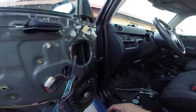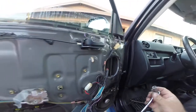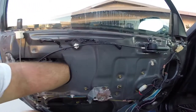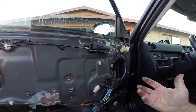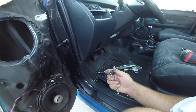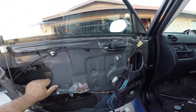So what I did was I unbolted the motor off of the lift mechanism first, which utilized an 8mm ratchet wrench. So I had to get my arm in there, and then I had my other arm in here, which got stuck 2 different times. And I took the 3 bolts out, got it in my hand. Then I took the other one off of there, which has Phillips head screws. I opted out on using those because it's much easier to tighten things in the door when you're like this than using the Phillips, and then you could get it tighter. So that's how I did it.